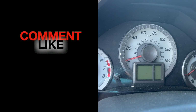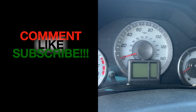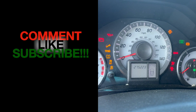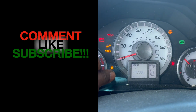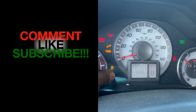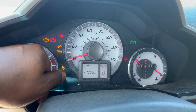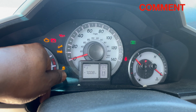After you're done with your oil change, you want to make sure you reset your oil life. Take your key, put it in the ignition, two clicks. You're going to see all the lights come up. Go to the trip odometer button and click through till you get to the oil. We were already at the oil, it's right here. You're going to press and hold.